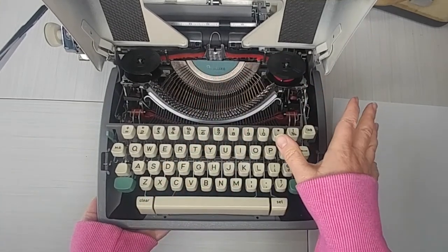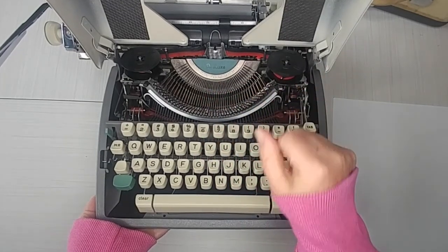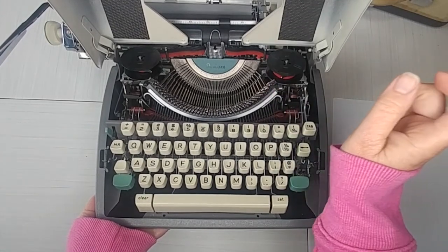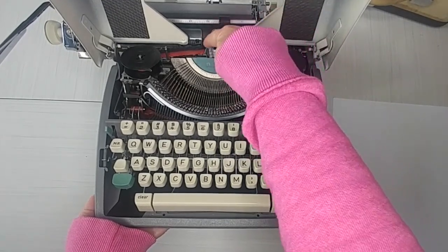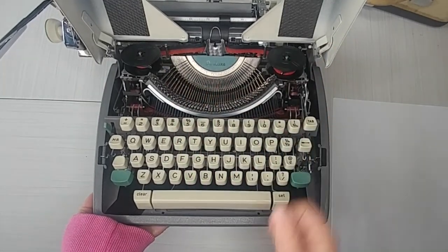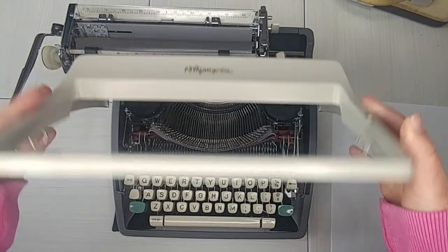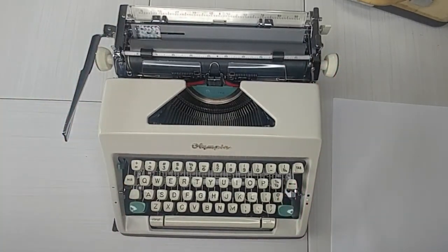Back and forth to use up all of that ink. The ribbon's not very long but it will last you a long time because there's a lot of ink in it. When it's time to change it, just pull these spring-loaded arms back, pull them out, pop a new one in, and make sure it is threaded through the guide wires properly. We have an up-close image of this on the website — use the link below. This is a very clean typewriter and I think you're going to love how it types.